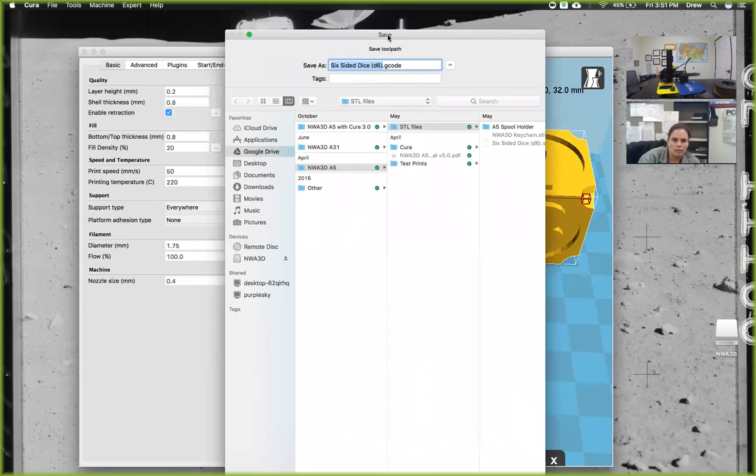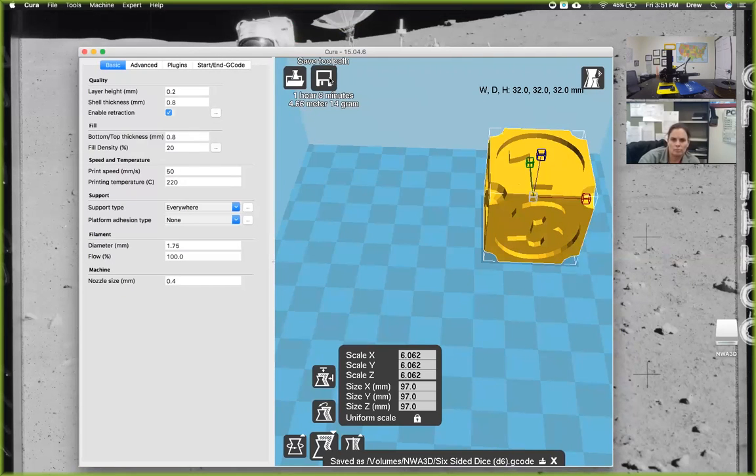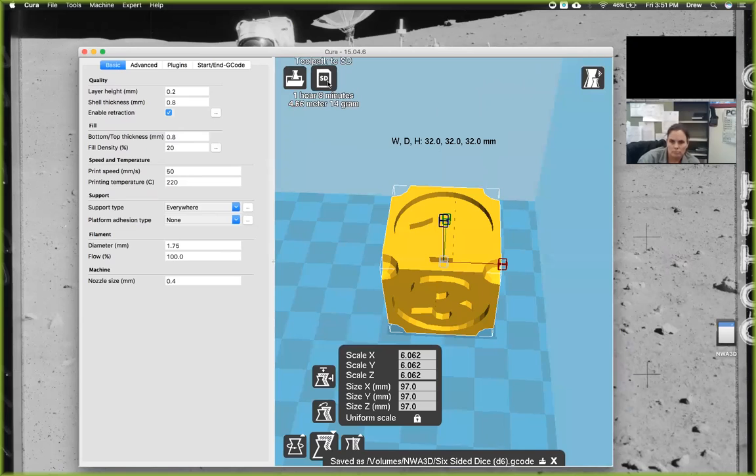Do you see that? I don't get that screen. I see your screen, but when I hit this robot and I hit that SD at the top. Okay, when you click SD, it's immediately saving it straight to the SD card, so you can skip that step. Yes, it's detecting it. If I eject this and plug in my SD card drive, then if you're using this reader, like on my Mac, it will pop up with the SD too. If you don't have it, it gives you this little thing right here. See, there's the SD. When you click SD, it automatically saves it.